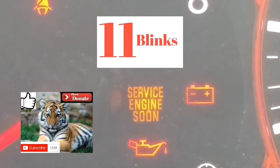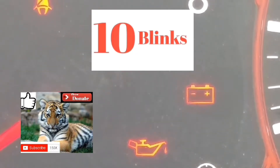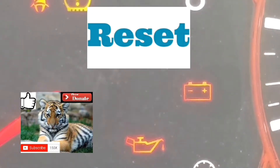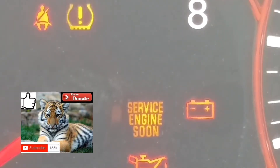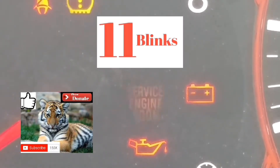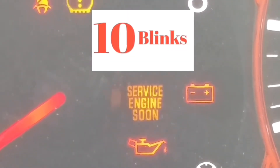Basically, there's going to be a P on every single one of these codes — they all start with a P. The first couple of blinks are going to be the slowest, just a pause. It's going to blink whatever the numbers are, pause, and do that for four numbers or letters. If it blinks 10 times, it's a zero. If it blinks 11 times, it's the letter A. Any number of blinks from one to nine is simply one to nine.